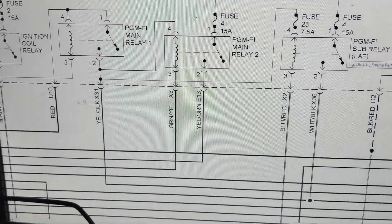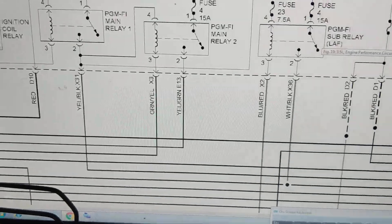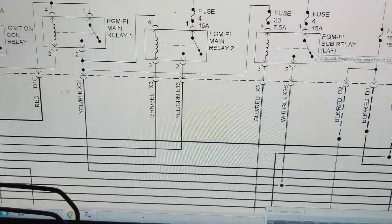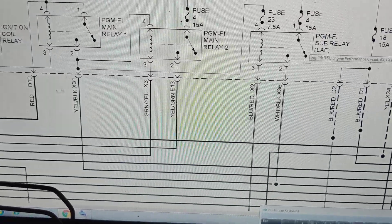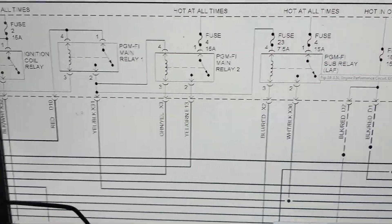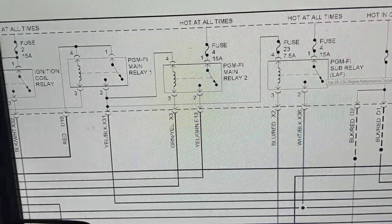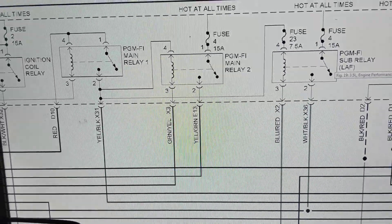If there's rust on a terminal and you put a meter there, you can't get an accurate measurement because the corrosion creates high resistance and you lose voltage across it. First thing: check and clean the terminals — they should measure close to zero ohms. I showed you how to clean them using a wire brush. Once you have 12 volts confirmed at the posts, then you apply the load tester. That's what it's made for — to see if the battery can hold up under load. But not when it's only at 10 volts on the charge. I hope that clears things up.